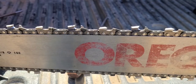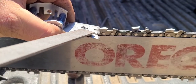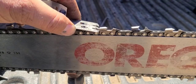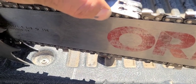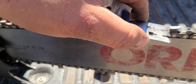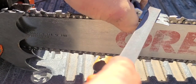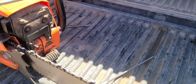After you're done sharpening, I use the Husqvarna sharpening tool. You lay it on there. Now look, there's no raker protruding. So I did all that sharpening. That's the hardwood setting, and this is the softwood setting. I'll bring you guys over here. Now you want to see, is it sticking through? It's not. So now you just want to take this and make sure. Some of these will probably be sticking up because we don't count strokes. We sharpen until the tooth is sharpened. I'm going to move you guys at a better angle here. There we go.